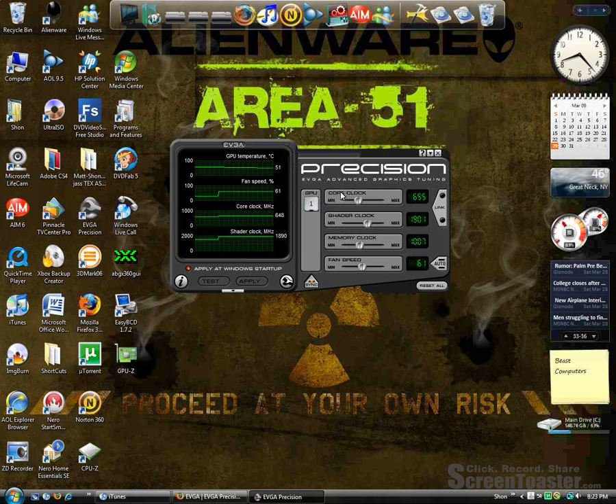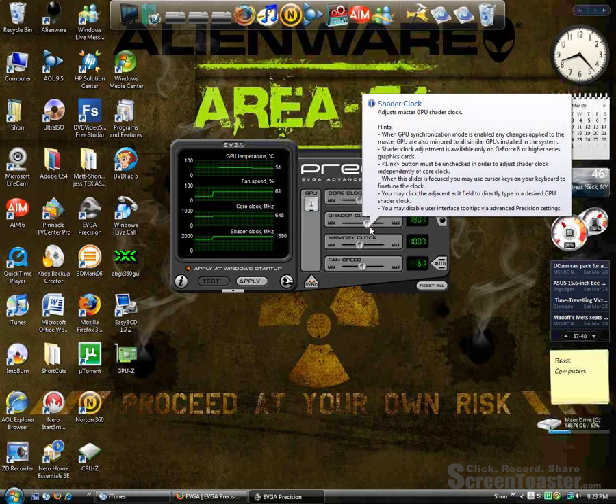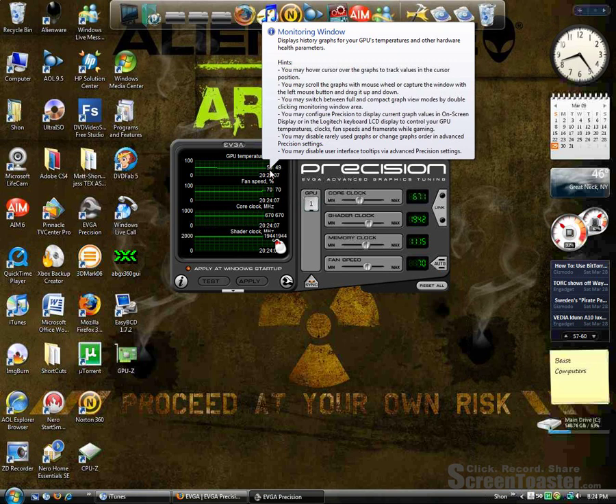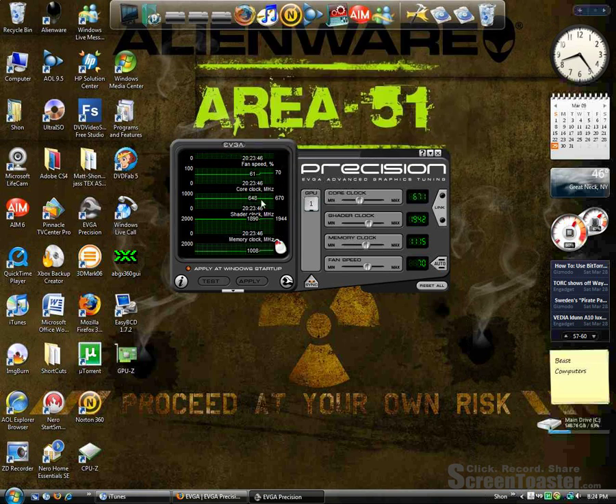So let's move on to a bit over the SuperClocked version. I'm bringing the core clock to 671, the shader clock to 1942, the memory clock to 1115, and the fan speed to 70. In this state the graphics card is pretty stable, and I like mine that way. You can always bring it up a little bit more if you want to risk stability a little bit. This is how I do it. Just hit apply and let everything go. I have three 120mm fans in my rig, so it keeps my airflow pretty good. The temperature is still going down — I'm guessing it's going to go all the way to 47. Fan speed is 70 and everything looks pretty stable.